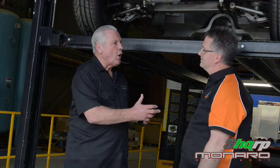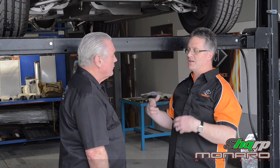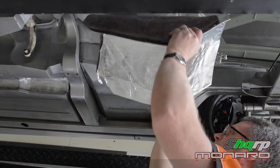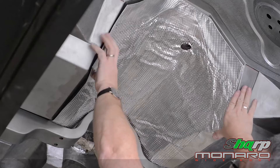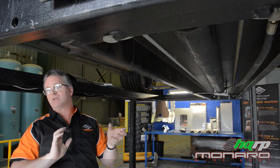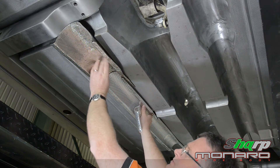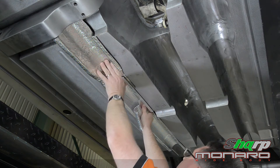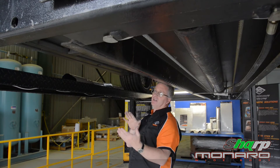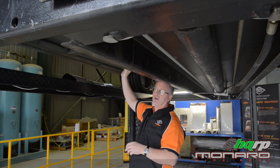Okay Damien, show me where you apply your product under the car. We'll have a look underneath at typically where we use the products in a hot environment. Above the transmission here we have a material that's both acoustic and thermal — it's above the transmission on most late model vehicles. You can buy that in your flat sheet, mould it to suit the shape of your transmission, fixture it up there and the job is done. As we move down above where the exhaust would be, because the material is so compact where you're limited for room, you don't have to have big air gaps anymore. You can see the different material where the catalytic converter would be, and then another material past that where temperatures are lower, so it doesn't need the higher grade.